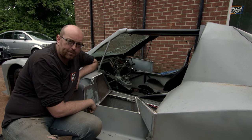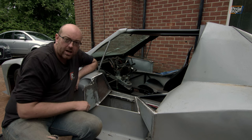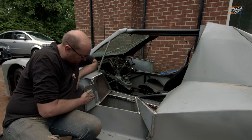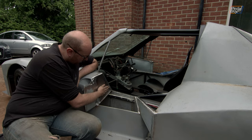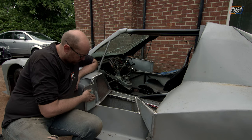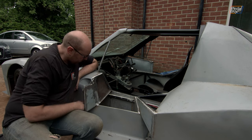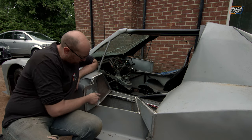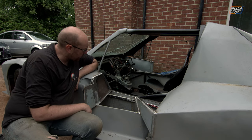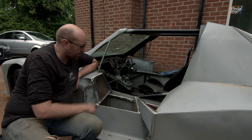That is much, much better. With that in, this whole panel side is complete. It needs a little bit of tapping with the hammer to make sure the ripples are out - there's a little bit of a bow here and a dip in there, and I actually don't mind it too much. I'll try and bring one section in a touch and see once I get some paint on it. I'll throw some primer on there and see what it looks like. But it's also tied into the very top edge of the wing now, which is really satisfying to see.